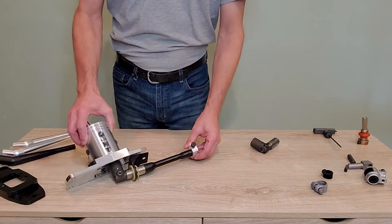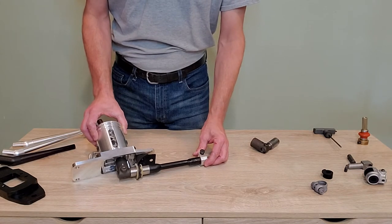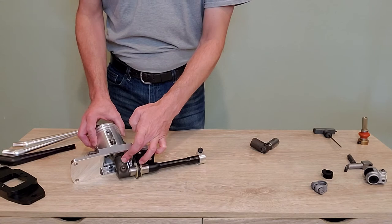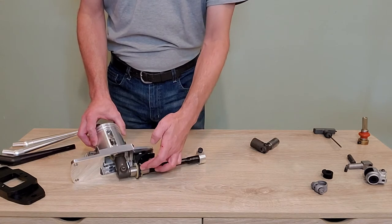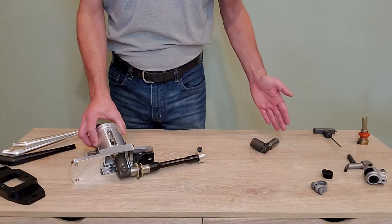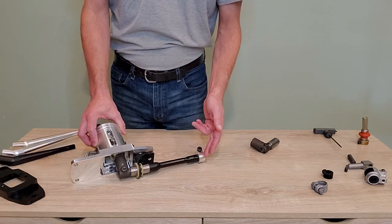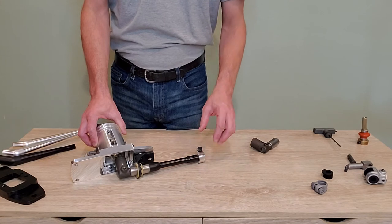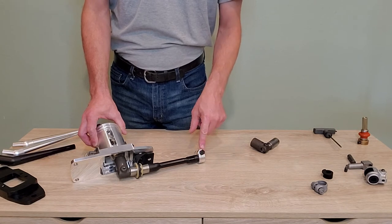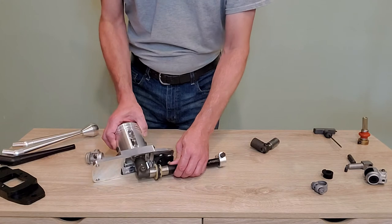First we'll start off with showing you a mock-up of the full shift linkage attached to a Renshift shifter. This is a shortened shift rod I use in my test rig, but we've got the shifter, the cup that goes up underneath it, and then the shift rod which rides in a rod bushing and the factory rod bracket. Yours will be a lot longer — about three times longer — but right in front of the back seats underneath the little cover in the center tunnel is the shift coupler. A clamp here attaches, and this is our J-West Engineering version which has just a bolt instead of a nut and bolt, which makes it much easier to perform the shift linkage adjustment.